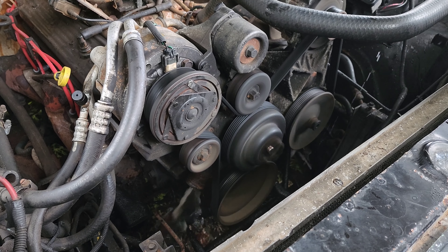Welcome back to the channel guys, we're back at it again with the Suburban. It's a little gloomy and rainy today but it's not going to stop us. What we're doing today is flushing out the cooling system because somebody put water in here, so we got a lot of rust. Before we put a new radiator in and the water pump, we want to clear the block of rusty water. We got new water pumps, new hoses, thermostat housing, thermostat, and we're going to clean up the engine a little bit because it's been sitting for a couple years.